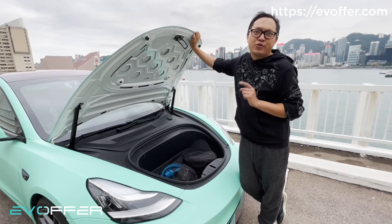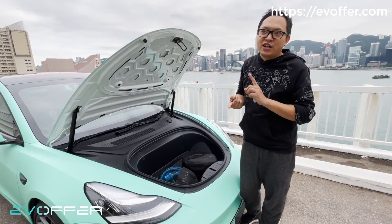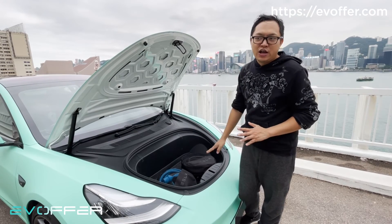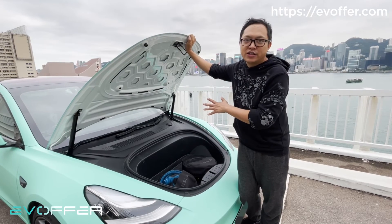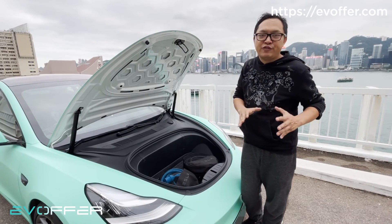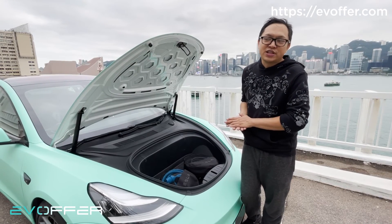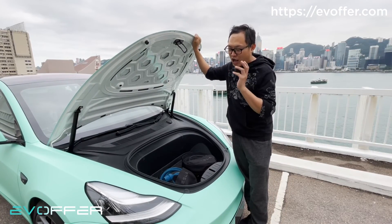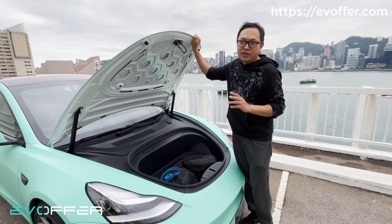This poses a big risk because you don't know how reliable that control unit is. The Tesla factory system designs a lot of safety features before doing the unlatch — for example, if the car is moving, the factory latch will not open the frunk. But you don't know how the third-party ECU is designed or how many preventive measures they've implemented. So if they take over control of the unlatch mechanism, that would be very dangerous. Our system depends entirely on the factory — if the factory does the unlatch, we open the hood; if they don't, we do nothing.